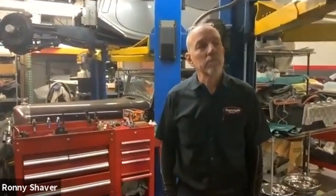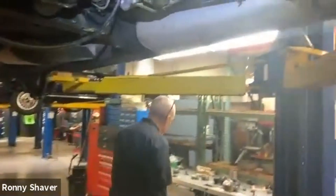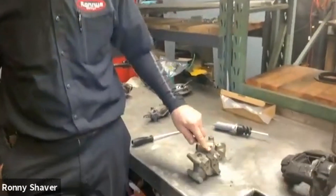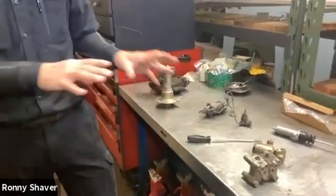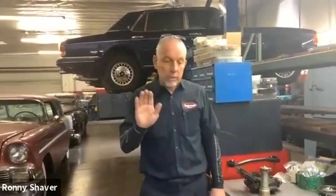If the car is leaking, get it under pressure and pumping before you put the rat trap back on to make sure there's no more leaking at all those connections. You cannot fix the leak at these distribution blocks. This little piston that's spring-loaded — there is no seal in that, it's just metal to metal, machined so close to tolerance that it holds the fluid. These won't have a pressure leak; I've never seen these leak under pressure, they just seep. The reverse effect is that it will seep air in sometimes when the car is sitting, which is why these brake systems should be bled out every time you service something — I recommend at least once a year.